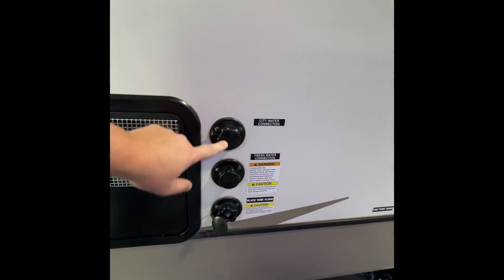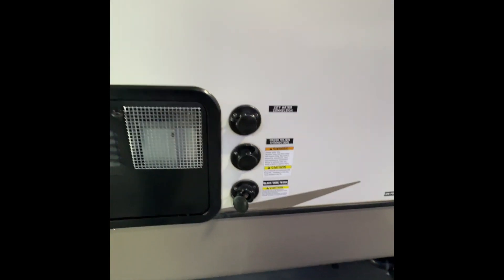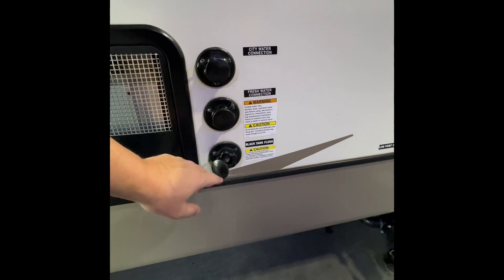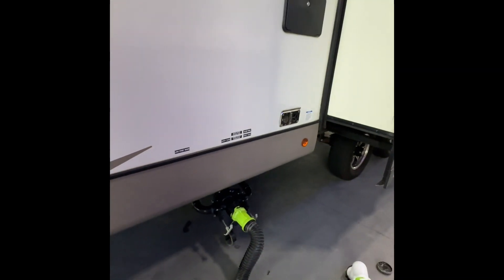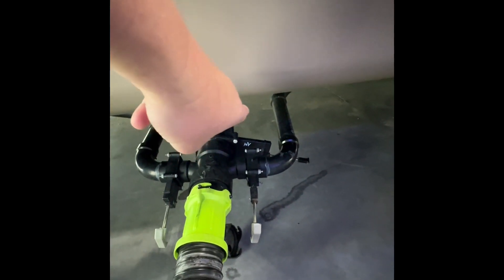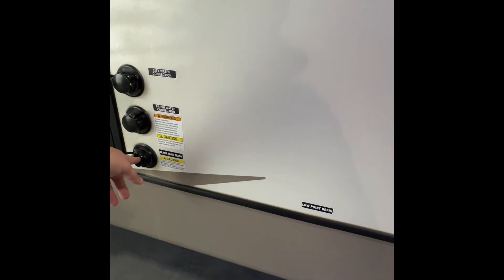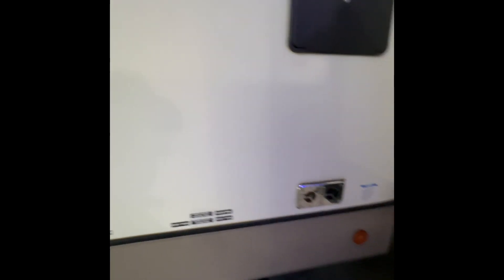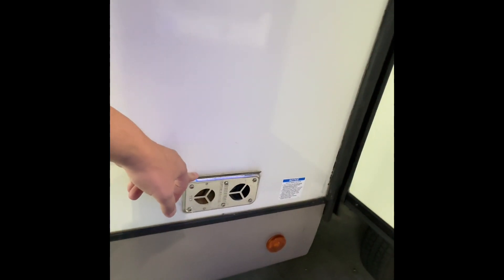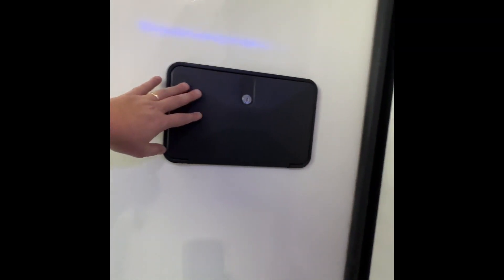City water connection right here and then a fresh water connection to fill the tank. Below this is going to be for the black tank flush to flush out the sewer tank. If you're going to hook a hose up to this, where it says black it's the big valve back there at the bigger outlet — you want to make sure that valve is pulled all the way open before you turn on the water, because if you don't open the valve the tank will back up and overflow through the toilet. Next to that is the exhaust for the furnace — if the furnace is going make sure you don't have anything close to it as it gets extremely hot — and just above that is going to be your outside shower.